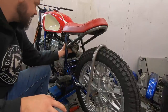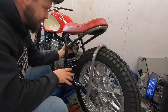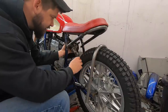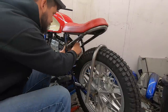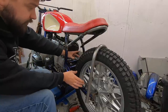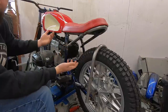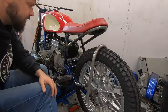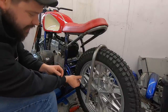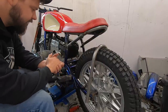The whole purpose of this bike is for me to get out of my comfort zone. What I need to do off camera is research the proper material thickness, how other people have done monoshock conversions, and whether they kept them adjustable or kept the rear frame section completely rigid — then just adjust the shock length for ride height. There are a couple of different options, but since I already have these heim joints, if we could use them and have that adjustability built in, I'd like to.